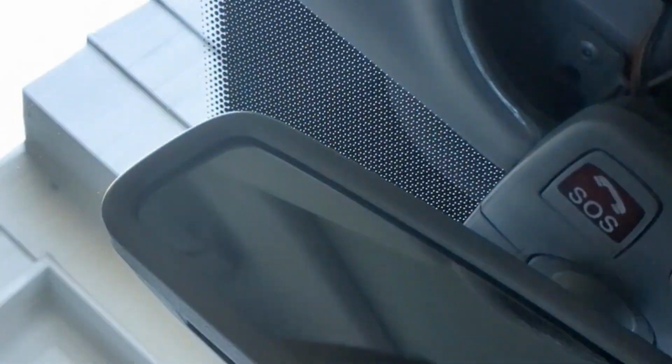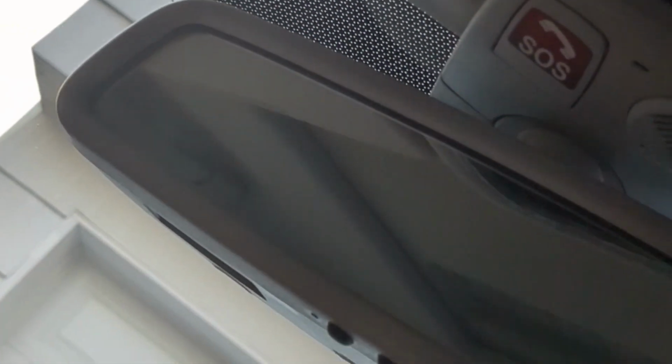And there it is. You see the resistor in that port. It receives that air passing through it, so it's able to sample the right temperature. And then you just gradually snap this back into position. The two tabs for the light bulbs just need to be positioned into their slots as you're putting this thing back in. Sorry about the camera, folks. It's just a little tricky.